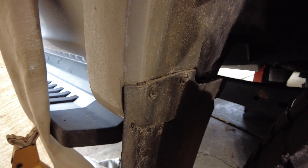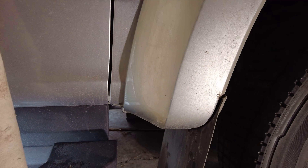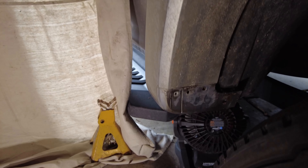First, I'm going to remove the mud flap. I think it's just three screws — we're going to pop those out using a ratchet. There's actually a screw right here and a push pin that needs to be removed as well. Mud flap off. Next step: fender flare. To get the fender flare, the first thing to do is the push pins — looks like one, two, three, four. We do have a push pin puller, just a normal cheap little kit from Amazon.